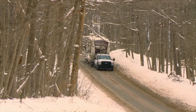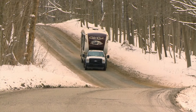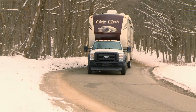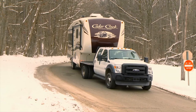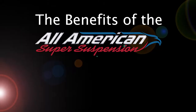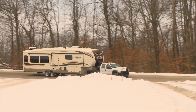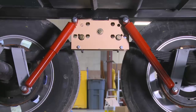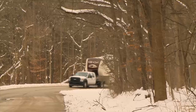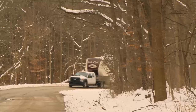6. Improved safety: An RV is heavier than the tow vehicle and will follow the tow vehicle while going forward. When it's misaligned, the tires will scrub, wear, and generate vibration. During a hard braking event with a misaligned rig, the RV's greater weight can take control of the direction of the trailer's travel. This can easily force the tow vehicle's rear end sideways, producing a jackknife or worse, depending on the weather and condition of the pavement. An aligned rig is far easier to control. Independent axle function also increases tire braking traction by up to 70%. 7. Increased comfort: A properly aligned rig massively reduces chucking because the two vehicles comprising the rig travel with each other. The patented Joyrider shock absorber ride control system, paired with Liberty Rider's independent suspension and Bullseye's alignment correction, eliminates vibration and chucking. It controls the jounce and bounce of the RV while also restricting sway, body roll, and the effects of high crosswinds.